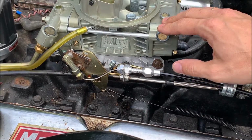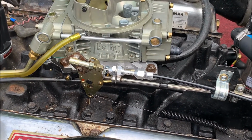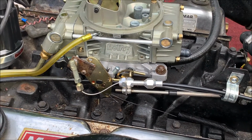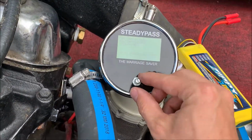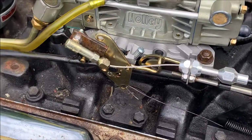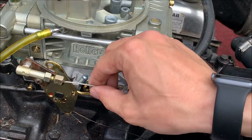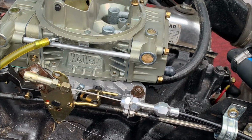So this particular carburetor has very short travel of the throttle arm. What this means, we'll need to limit the maximum servo extension so this doesn't happen ever, because this is not helping. This may just get in the way of control. Put it to full throttle just to make sure. Yeah, that's full. So still too much. The way you take this slack out is go into the max servo menu and decrease that value. Again, watch the cable as I twist the knob. Yeah, so in the maximum throttle position of the handle, I would set it to where the cable is just a little bit tightened, but definitely not. That's full, okay.